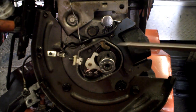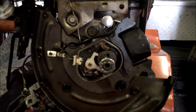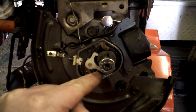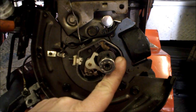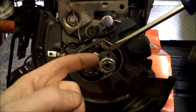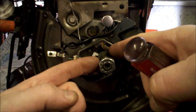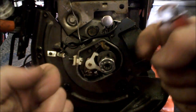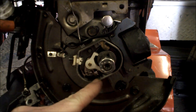If your points came with more grease or a new felt pad, just pull this old felt pad off and put a little new grease on it. If not, you can apply just a little bit of grease in here — just a little bit. Now, if you have oil in here, that will foul your points, and that's because your front seal is bad. You can get to your front seal just by this piece here — this eccentric, your camshaft or crankshaft timing gear, whatever you want to call it — it just pulls right off with your fingers. You can access that seal right there and pull it off, because it'll just keep fouling them.